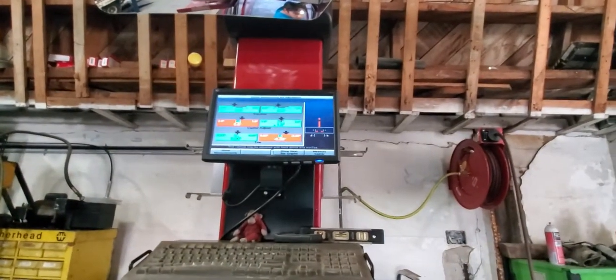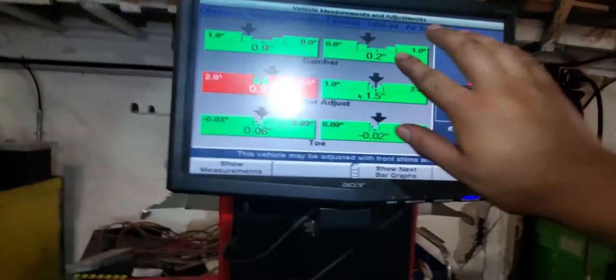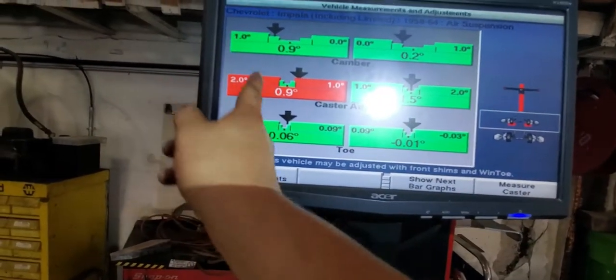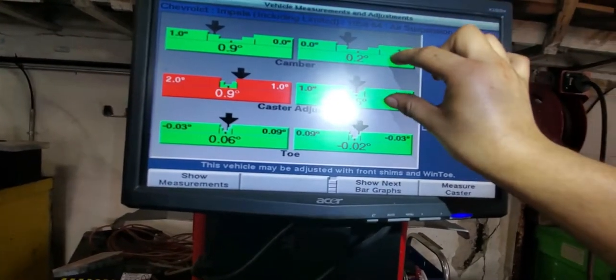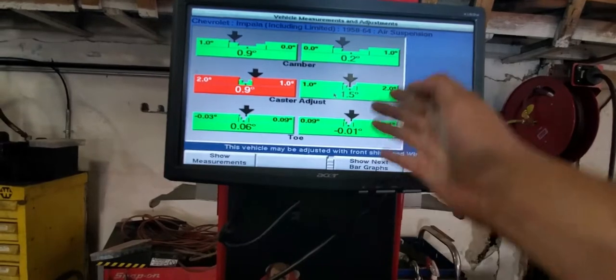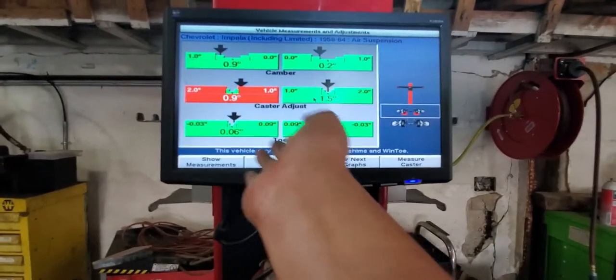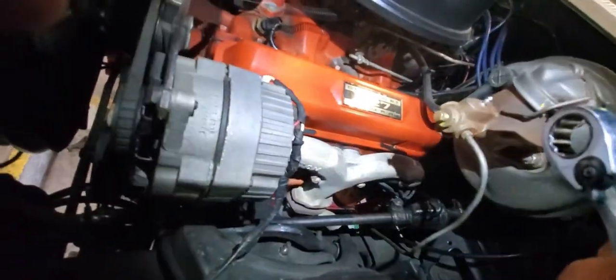You have to make sure the toe is mostly in close range so you get more accurate readings. This side is already fine, so we'll focus on the other side. Once we get that side stable and centered, we go back to this one and do it right — because you have to work both sides at the same time. If you just align one side, it compensates the other side and probably goes more negative or positive. There's probably a chance we'll be adding shims in the back on this one.